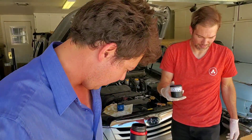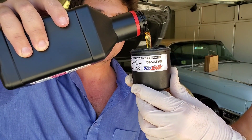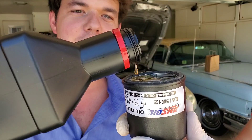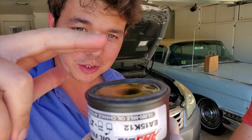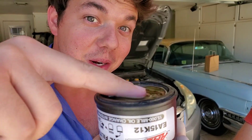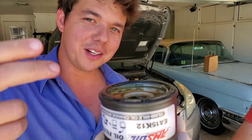Let's prime up. Come on over here, Owen. Hold it up a little higher right here. Now you're going to see the liquid gold go. We're going to get a little closer — follow the oil. Keep going in a little more, and you'll see it slowly bubble over the top. Right there — we should have a couple little air bubbles popping in. Now we're going to come with two fingers, get her nice and wet on our rubber gasket. Once our threads are nice and wet, we can confidently thread her on and we're good to go.